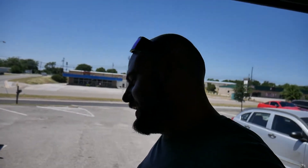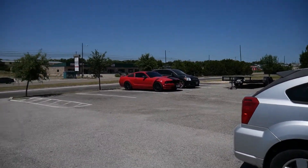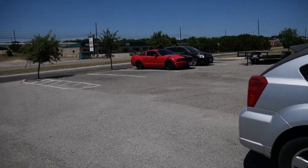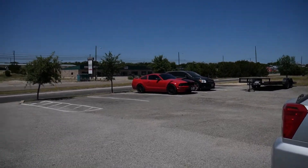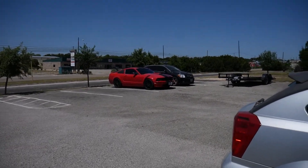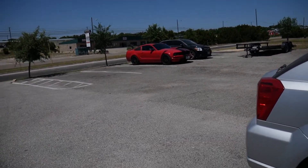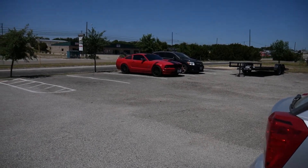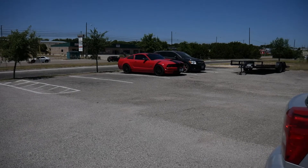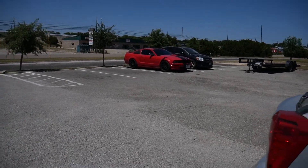We're on the next day here and the dyno is empty because we pulled that Mustang off. It has some other issues preventing us from tuning. We went ahead and changed both upstream O2 sensors and got that squared away, but it's got some other check engine lights. The customer installed his own camshafts and did not use the tool to hold the chain in the proper place when you don't remove the front cover to install cams. After testing the camshaft sensor and phaser sensor — and both testing good — we're pretty positive that the timing is off a tooth, perhaps even two teeth, and that's what's triggering the check engine light.